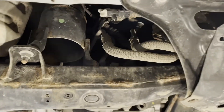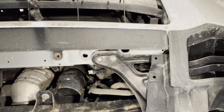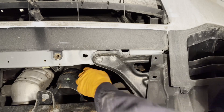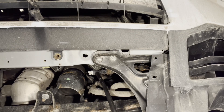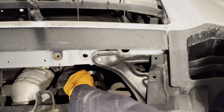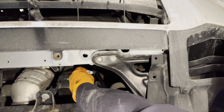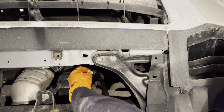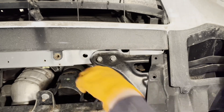The hybrid cooling system drain plug is located right there. You can just open it and drain that way, but it will splash and make a mess. So I use a 5/16" hose, put it onto that nipple on the drain, get a suitable container underneath it, and then open the drain plug and let all the coolant drain out. Once the coolant stops draining completely, close the drain plug and remove the hose.